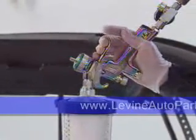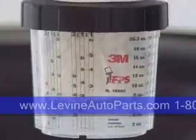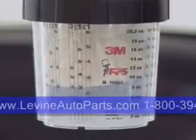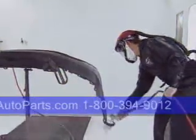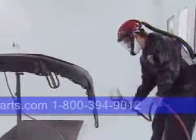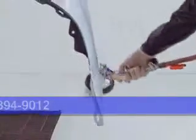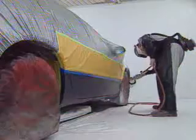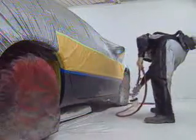Keeping the mixing cup upright, attach an air hose and carefully pull the trigger to bleed air from the liner. The liner collapses until only paint is being delivered to the spray gun nozzle. This feature offers you terrific productivity because now you can spray with the gun held in any orientation. Difficult angles, even spraying upside down, is a snap. Your spray gun is now a closed system, and the liner continues to collapse as you use up the paint.